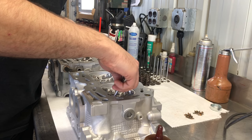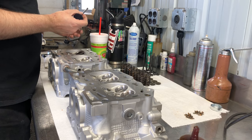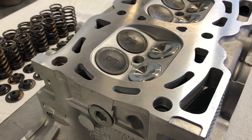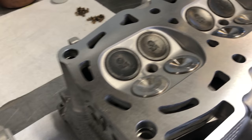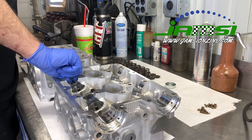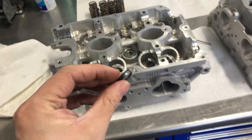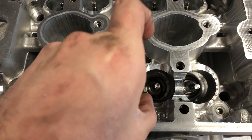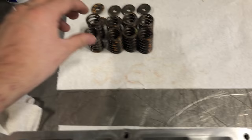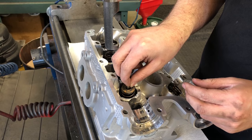The intake valves were reground, and the customer provided a set of Manley Stainless Race Series exhaust valves. When installing the valves, we put a little bit of assembly lube on the valve stems. I wanted to say thank you for watching and remind you that we are not only a machine shop — we're also a worldwide distributor of engine parts, working with various partner warehouses and brands to sell a wide range of engine parts from budget stock to top-of-the-line performance parts. Be sure to check out our website for U.S. shipping and our eBay store for international shipping, linked in the description. Here I'm installing the valve stem seals, and that elusive 10mm socket is the perfect size to aid in pressing those seals into place. Can't forget the shims or locators that go under the valve springs.